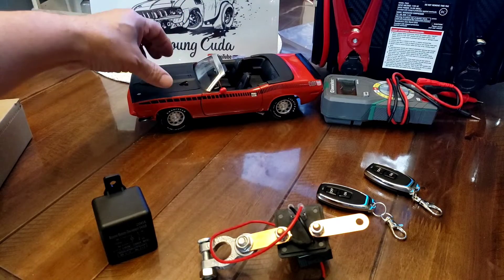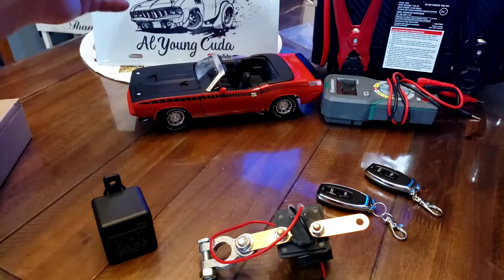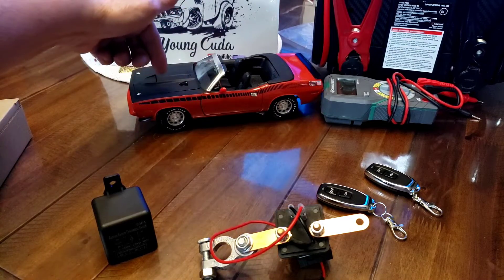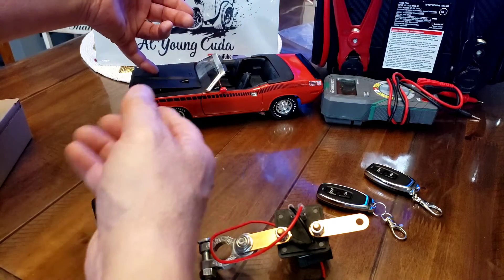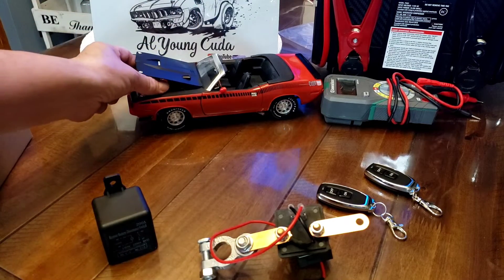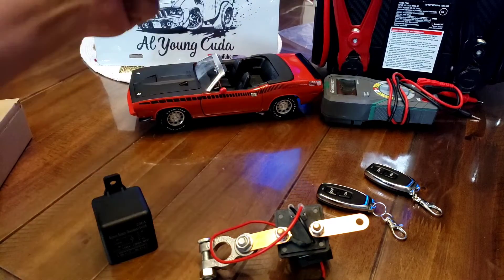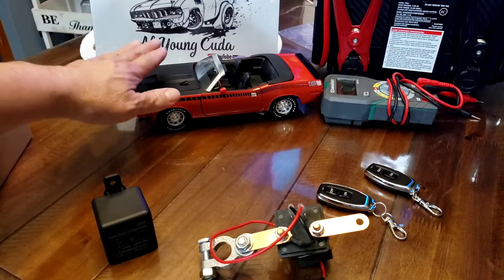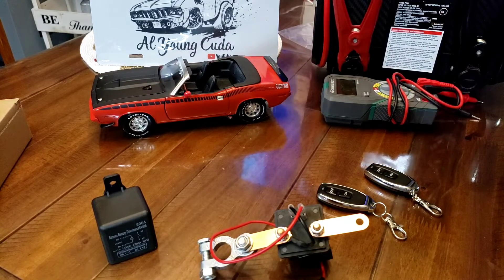The whole idea is to lock it so nobody can get to it. Same thing with a burglar alarm — sometimes the siren is right underneath the hood. Someone gets in there and rips the siren right off because they can hear it. Most sirens are installed on the side of the fender, usually closer to the battery — you just pull the wire and the alarm is off. So you need to lock the hood. Get yourself a nice old school chain lock — remember the old Chapman locks, the old Maxi locks? Those were a great thing.